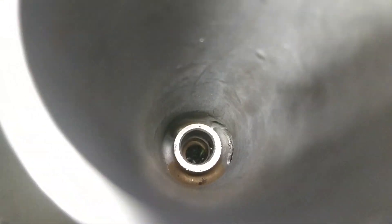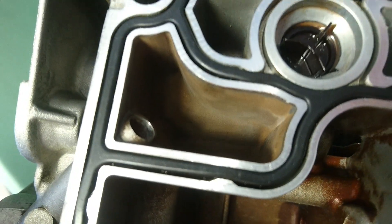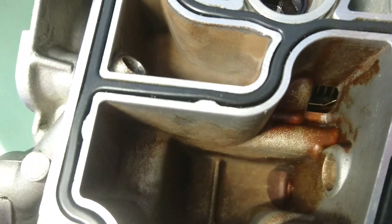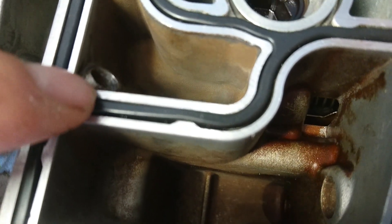When you look at this hole and go all the way down, by fitting the oil filter cap housing you will plug that hole so the oil cannot pass through. Only when you remove the filter will the oil seep through this hole. This is how the original cap is designed to manage oil drainage.